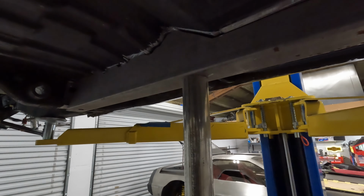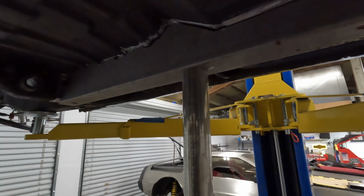I changed my mind, these things suck. I got the passenger side in there now, and it kind of matches, but look at that big old gap. So that means I gotta cut that weird profile. See, it's touching here. I mean, it's close, but it's not the same. I think it'll be safe to say I could probably take a quarter inch off the whole thing. I think it's just these points on this side, and then this side it's touching, and it looks like it's touching in there too. And then it's touching hard all the way across here, so that all needs to come down.